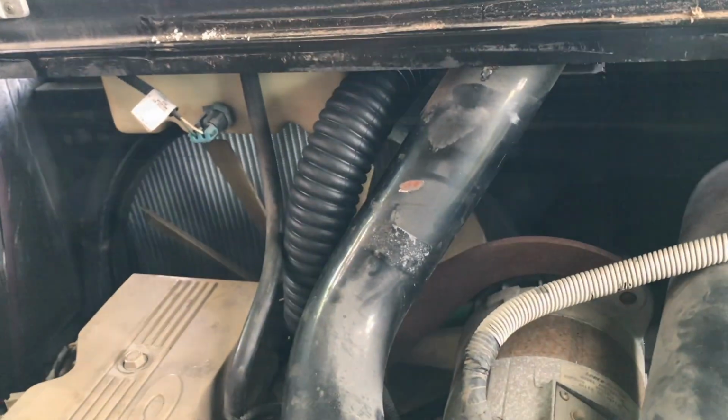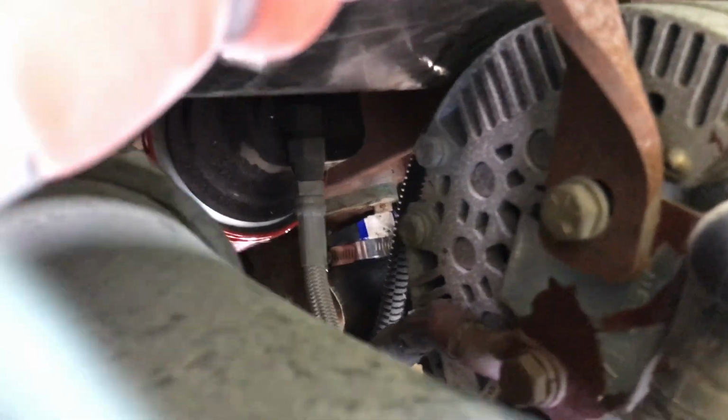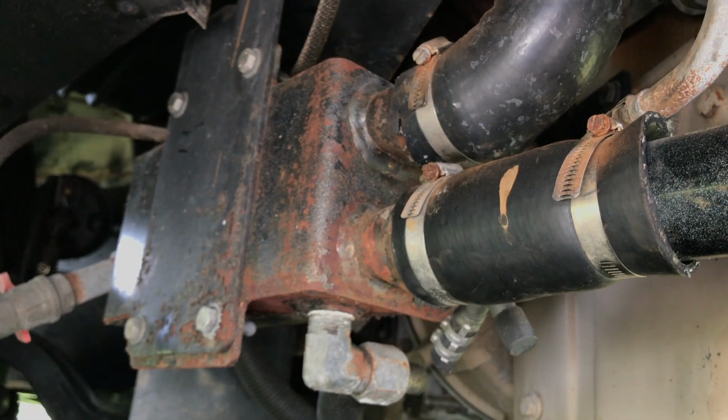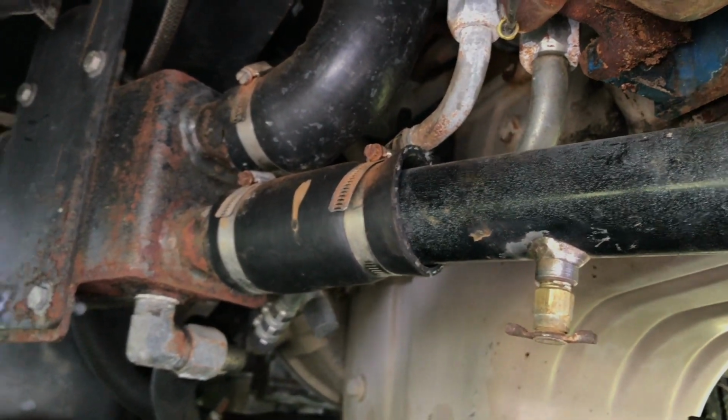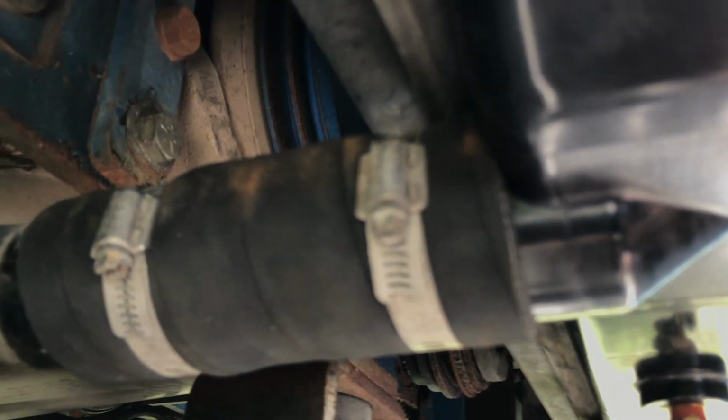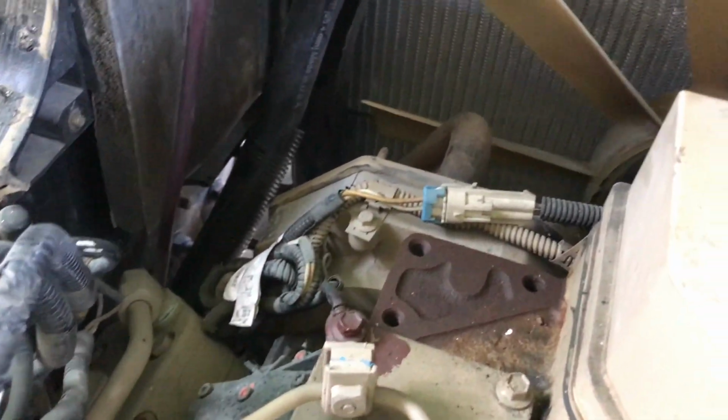All right, let's go over a quick recap. After replacing the radiator, we installed new radiator hose. So right there in the middle, you can see a new lower radiator hose. And that connects to our transmission heat exchanger, also transmission cooler. Then it leaves the transmission cooler and runs through the metal line to the bottom of the radiator. We also replaced the overflow tank hose, which as you can see goes under the engine and back to the bottom of the radiator as well.